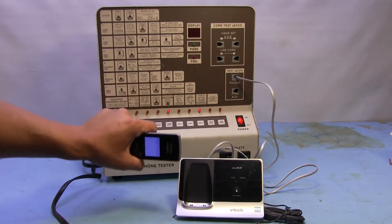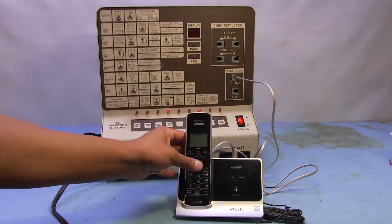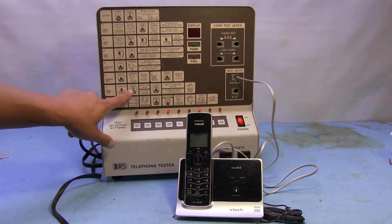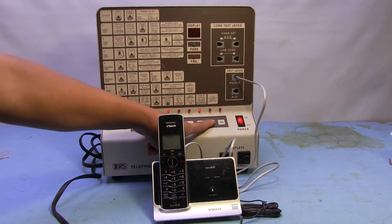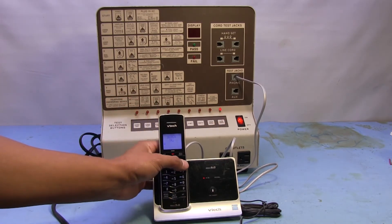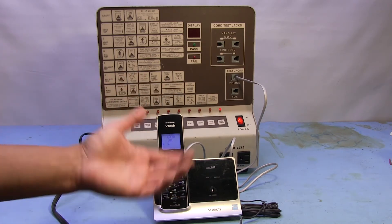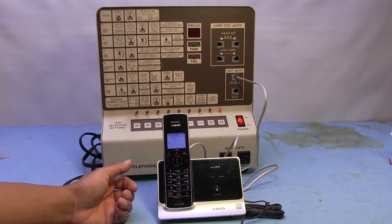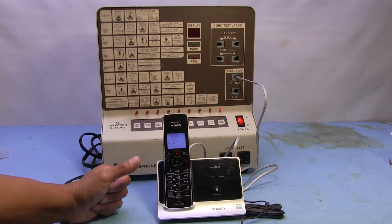Okay so step 6, the short loop setup — that's only if you want to test a few things, so we're going to skip that. Let's do the ring test — hang up, push the high ring button, which is this one right here, and the phone should ring. And that's working. Let's do the low ring now — I don't think it'll make a difference on this phone, but that's for an old school ringer phone with the actual magnetic ringer — it could do a low or soft ring. This one just does the high ring as soon as it detects the incoming call. Our phone passed all the tests.